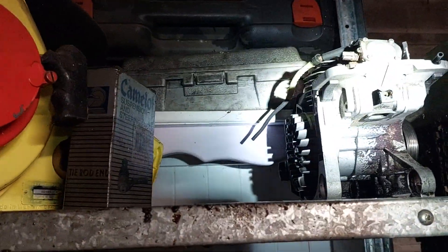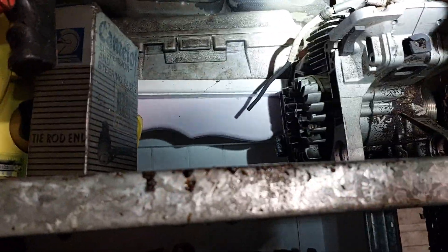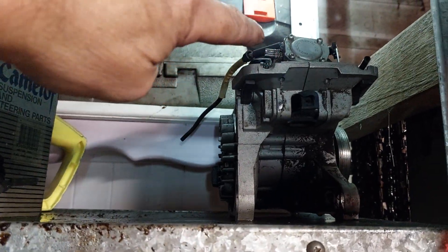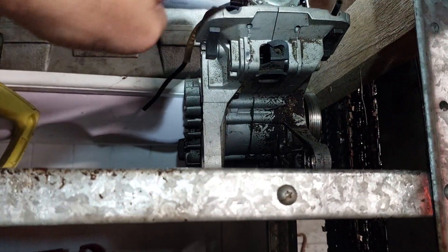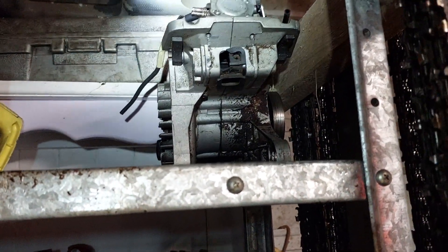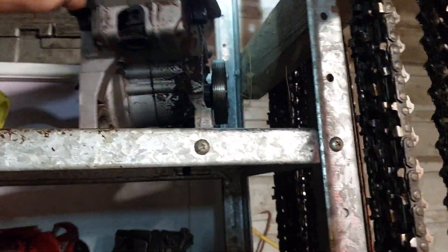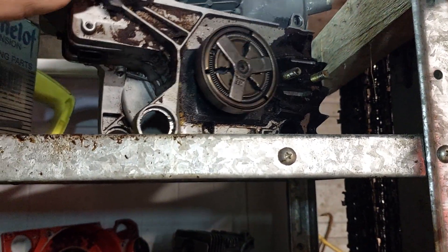There's Frankenstein. I need to sit down and do more work on Frankenstein. I've got the 395 XP boot so I can put a proper air filter off the carby. I need to buy wide-sized bolts to screw into the baffle plate at the back, make a bracket, and get a big air filter on top. It's a 372 carby. This thing rocks — it screams power-wise. I'm very happy with it. It's only a Chinese chainsaw with a 48mm piston but it goes harder than you can imagine. Trying to get the carby to match up and do what it's got to do — it just doesn't want to work. I need to get the air filter and all that sorted.